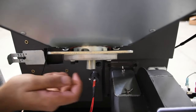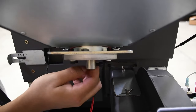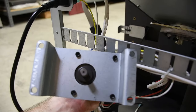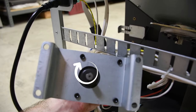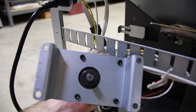Now try spinning the auger bit by hand. If there is no jamming, the bit should freely spin in either direction. If the auger bit appears to freely spin, you can try powering the stove back on and activating the auger using the diagnostic menu. If the top post does not spin slowly while the auger feed indicator is shaded, this could indicate a problem with the auger motor.